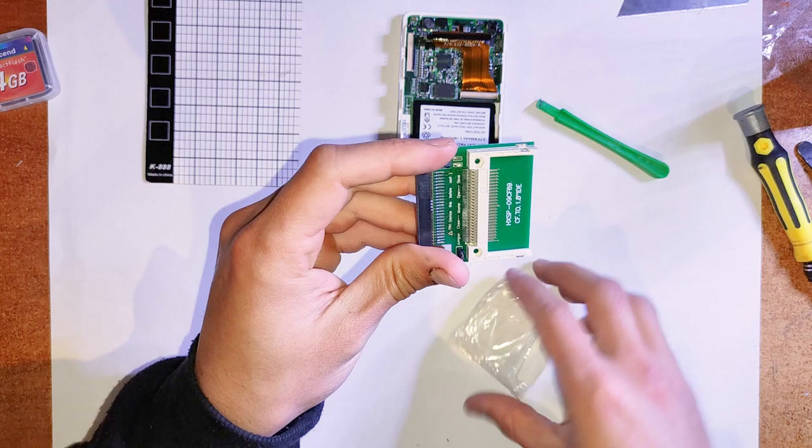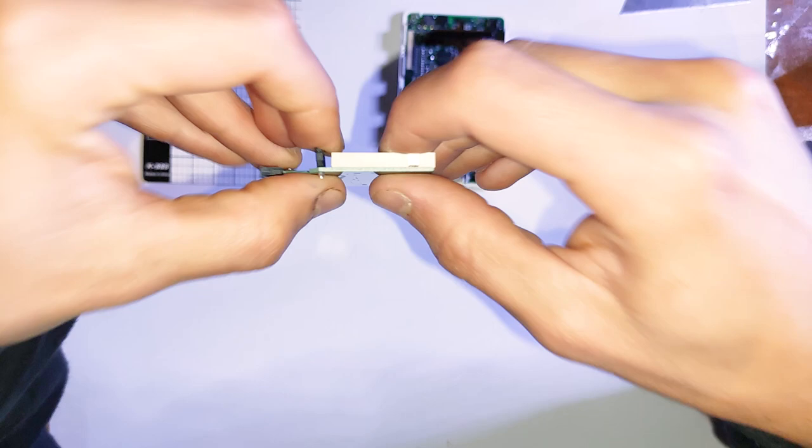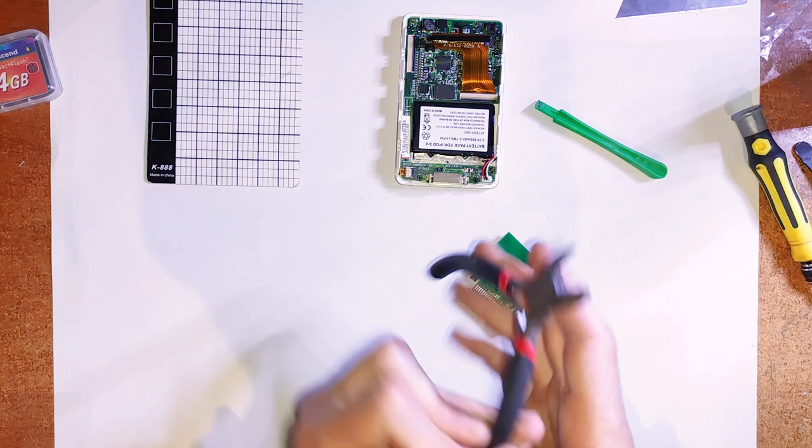So yeah, what I do is I like to push down those pins, the master slave jumper, because sometimes that can push up against the housing and cause a short. And I also like to cut down these two little pins at the bottom here, because again, those can short on components on the actual logic board itself as well. So what I do is I just snip them back with the pliers. And then I also like to shave them down flush with the,